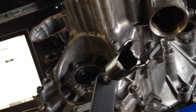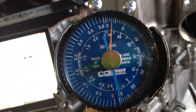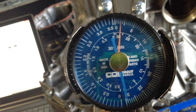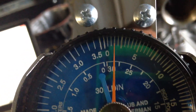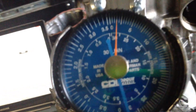I hacked it up with a grinder and it fits snugly right in there like it was made for it. This is a zero-to-30 inch-pound dial torque wrench. I'd recommend the zero-to-30 - I think there were only one or two available on the market. They do have zero-to-60 and 75 and whatnot, but when you use those the scale window is smaller and each line is harder to read. We're dealing with very small specs - 6.9 to 13.9 inch-pounds - so just get a zero-to-30 so you can actually see it clearly.